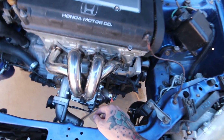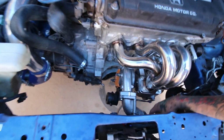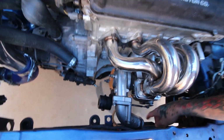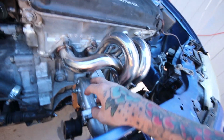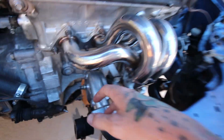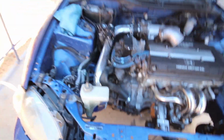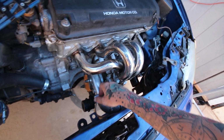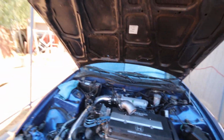And now I can start fabbing up the downpipe. That's also going to be tricky because I need to basically get a 180 and then wind it back there. I can cut the fuel line now and get my length for that and put that on. And this also makes it a little bit better for the oil feed line, although this bracket may be in the way. I may need to cut that off and re-weld it a few inches over, like an inch over. Maybe I'll have to run the line really quick and see how that looks. But so far, we are looking pretty gravy. Actually looking now, I can't even put the feed line on yet because I have to get a fitting for the turbo. But that's okay. And then water lines, and still waiting on the fuel pump. Fuel pump should be in tomorrow.